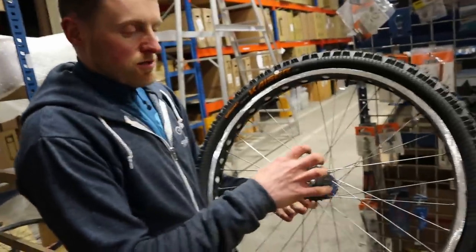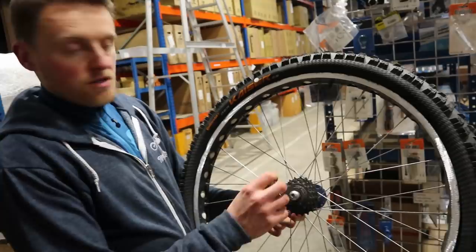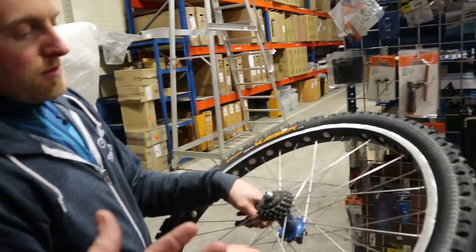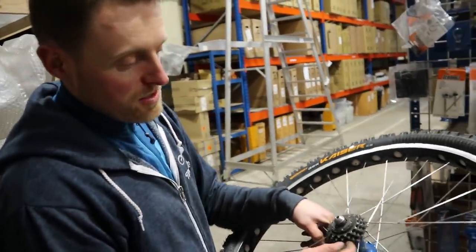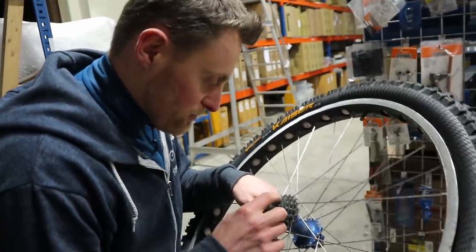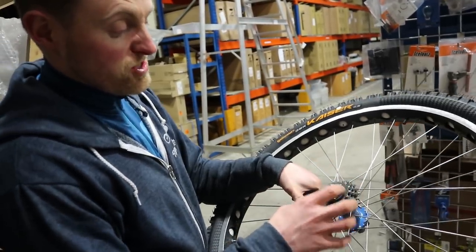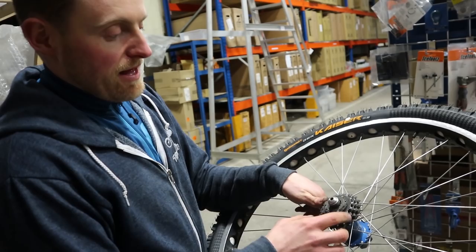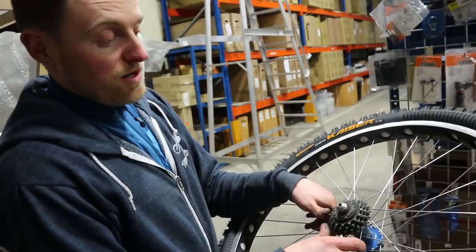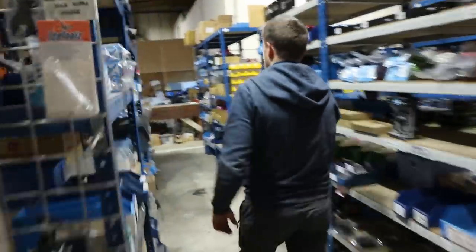You mentioned possibly chucking a single sprocket on there with some spacers to get rid of some weight and neaten it up. I think this is going to be one of the cheapest and easiest ways to save some weight from the back of the bike. That's four big lumps of steel with some cut-down weird spacers. A single speed sprocket for this hub is about four or five quid, and a set of spacers is less than a tenner — so you save quite a lot of weight and neaten it up without spending much.